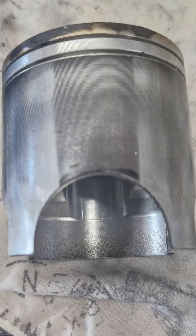Looking at the other side — the inlet side of the piston — you can see there are two vertical lines down there. A couple of things that suggests: one is that when the piston's been getting hot it's been expanding and touching in that area, so again maybe it's just a bit lean. But most likely with those vertical lines, that would suggest that it's been run quite hard from cold without letting everything expand as much as it should.